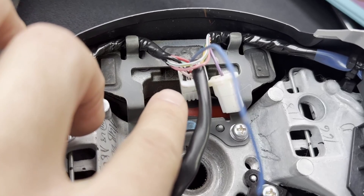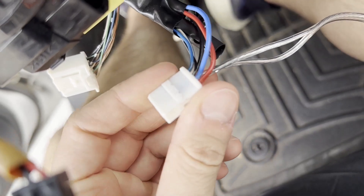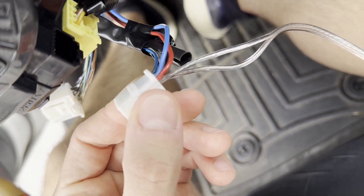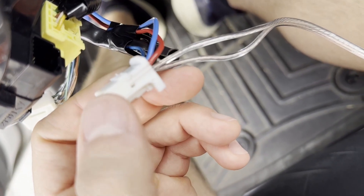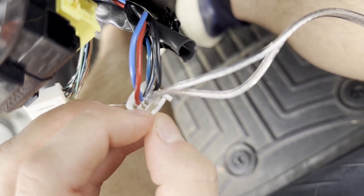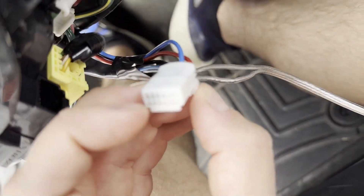This is all dependent on where you place your wires in the connector. I also didn't show how to take apart the connector and insert the pins, so I'll cover that now. Both connectors are similar and come apart the same way. You'll need a pick to pry up this little piece of plastic — you can see how it's raised up. You just need to get it up like that; it doesn't have to be fully out, because there are little slots inside.